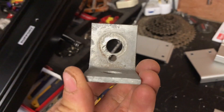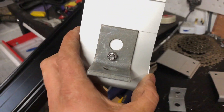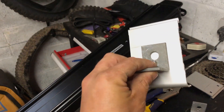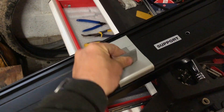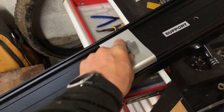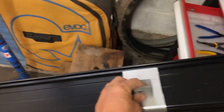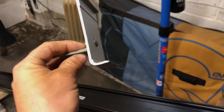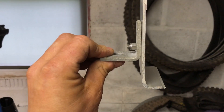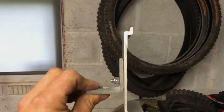We've drilled a smaller hole — that one's a bit close to the other hole, we'll bend that and redo it — but there's one that's done. We've drilled the hole, then we've pinned it to this extrusion and then that basically slots into that slot there. There's a pin that goes through the bottom bit, pins it in, and then that fixes to our roof rack that we've made out of unistrut. We're going to have one, two, three, four supports. Once we've made them we can fit them on the unistrut roof rack and then we basically hook our awning on that, fix it, job done.